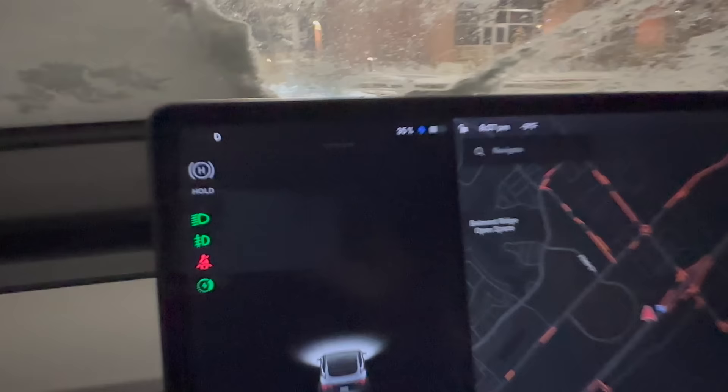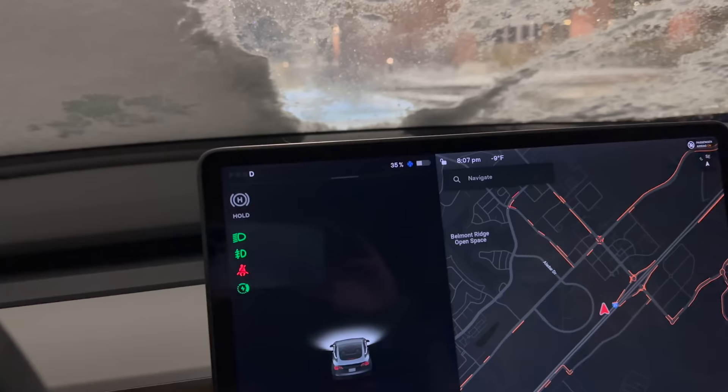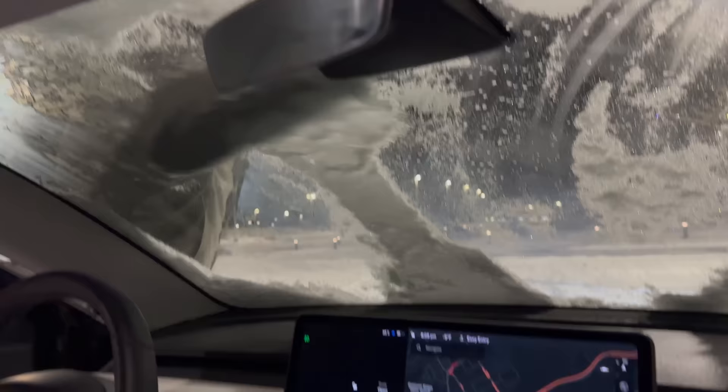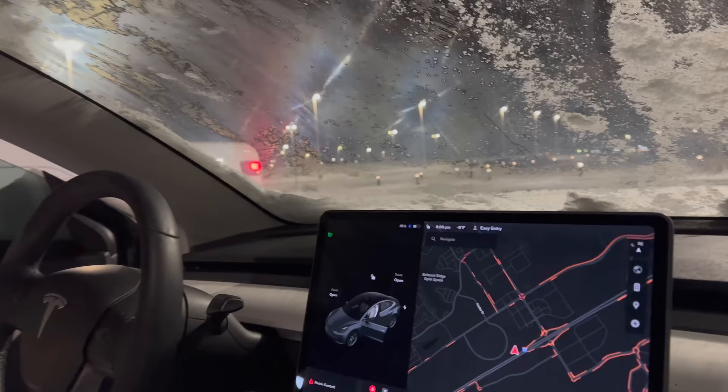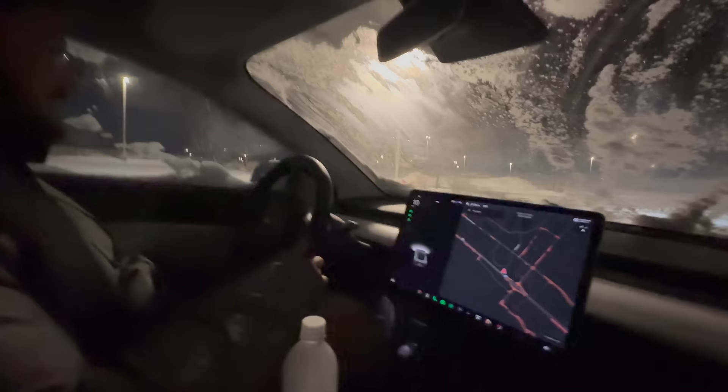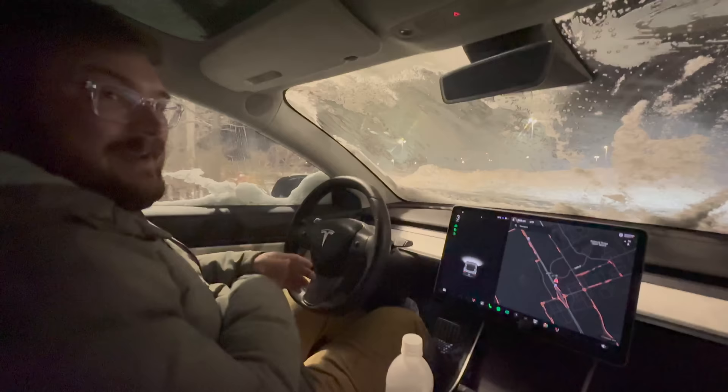I have never seen it that aggressive. I don't want to be too harsh on the battery pack and I want to get it into the charger before too long. The regen limit is on and the seat belts are frozen — everything is frozen in here. I'm not going to floor it or do anything crazy. Let's just drive around the parking lot here quickly and see — do we have any regen? I'm fully off. Not even a hint of regen. The battery pack doesn't want any energy whatsoever. Let's go plug this thing in — this frozen brick of a Model 3.